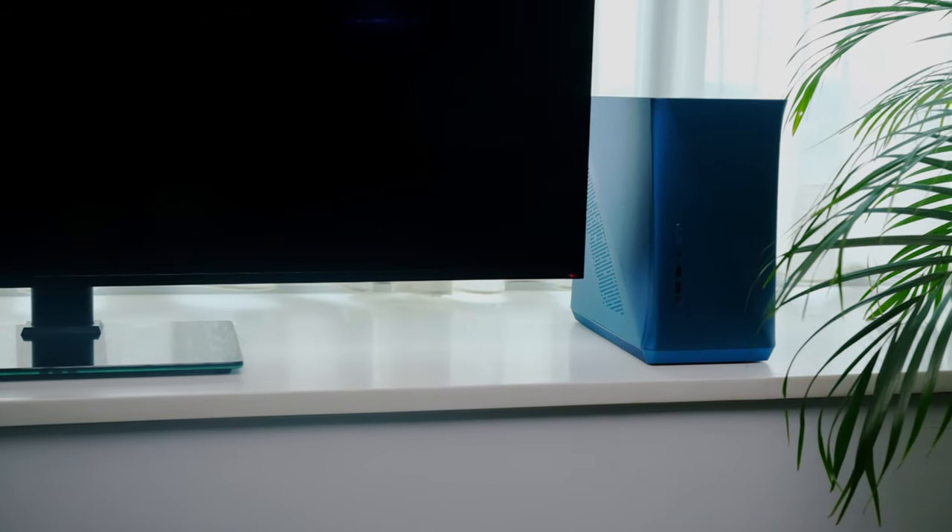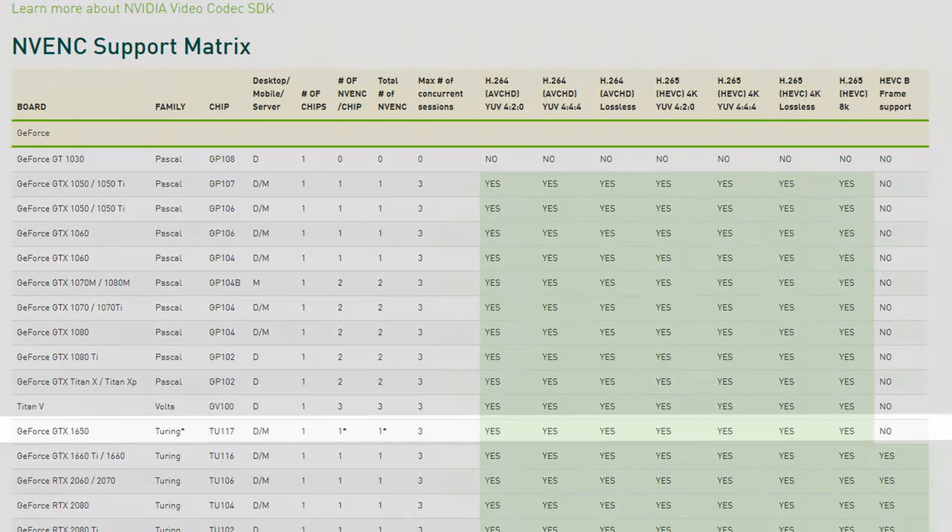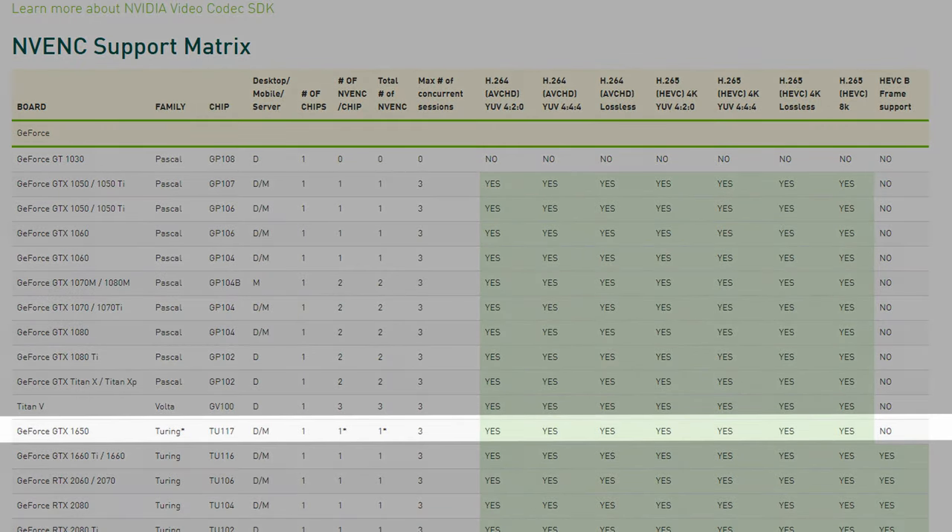This is certainly great for creators, but it also applies to people who do game streaming — provided it's not a triple-A title, as we demonstrated earlier you don't really have any spare GPU horsepower to do both. Another great use case is for dedicated living room PCs used as media servers. This GPU supports NVENC, so you can enable hardware acceleration, and it will be sufficient to speed up transcoding to watch 4K or even 8K movies on the fly, supporting up to three displays pretty smoothly.